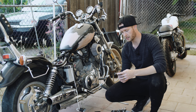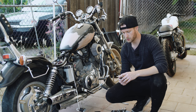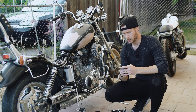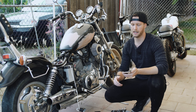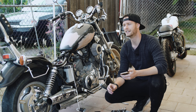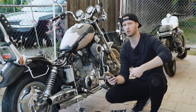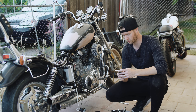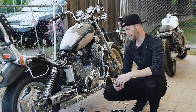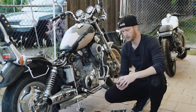I need handlebars, of course, for the bobber look, and I need a bobber seat. I need a new battery — I'm sure this one's been sitting far too long. Both side covers; I want the stock side covers and I'm just going to put those back on. I need spark plugs. I need a bolt for the highway bars on the left side — one bolt is missing making the whole thing loose, which is also making shifting hard. I'm going to replace the mufflers since they were clearly drilled out and are probably really loud — I might replace the whole exhaust system or just the mufflers.